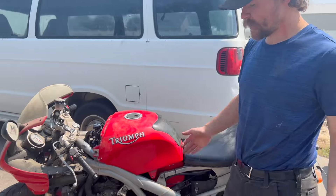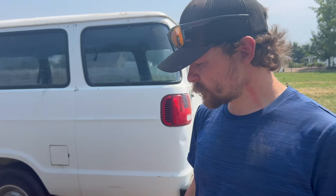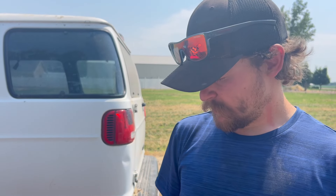So we made a lot of progress. We got this thing running and driving after it had been sitting for quite a while. Definitely still got some things to sort out. Seems to be running pretty good, but if something isn't quite right it may just need to run some more. The main thing is that kind of clattering which seems maybe like timing chain. Next time we'll pop the cam cover off, take a look, make sure everything's good there, and hope it's not bottom end. We also need to go through and clean up all the fairings, maybe do some plastic welding. Made good progress this time and I'll see you in the next one.